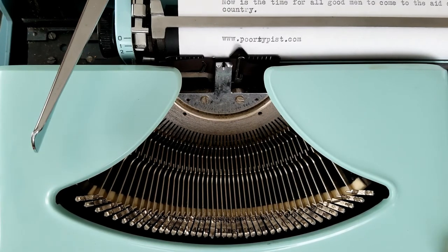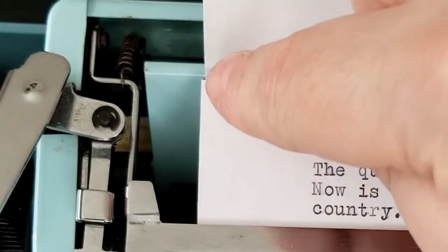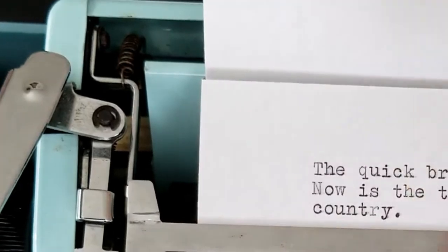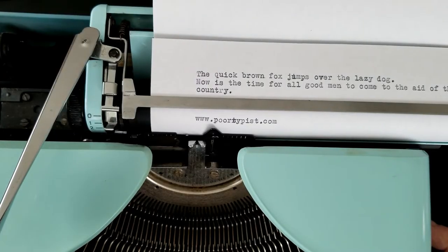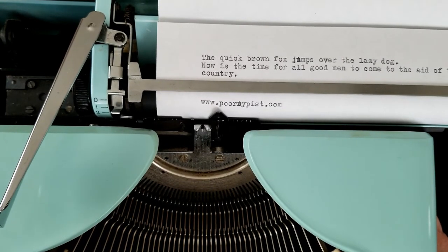Oh yes, as I was typing on it, I realized that the paper shifts a lot. You might be able to see it right there. It's already starting to shift right there. I had this perfectly aligned when I started, and already, just after a few lines, it's shifted. So I suspect there's an issue with the feed rollers. And that's not something I've ever dealt with before, so I'm not sure how to go about fixing those. But that's definitely an issue